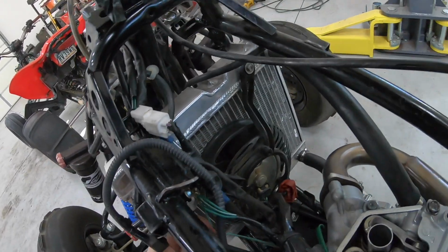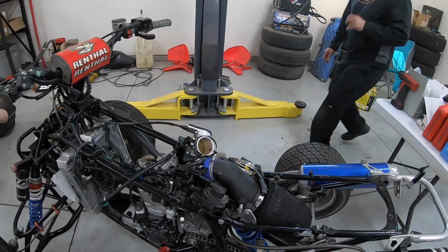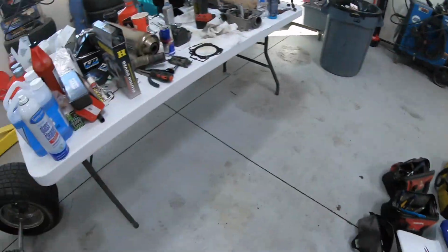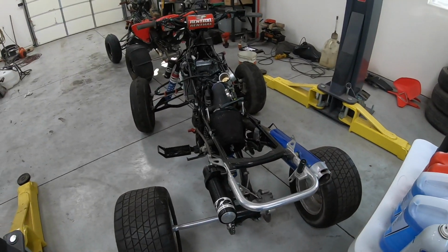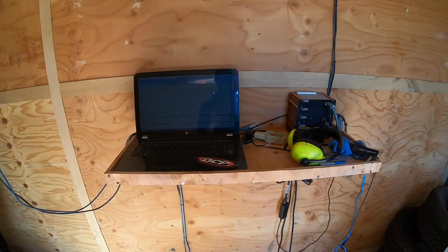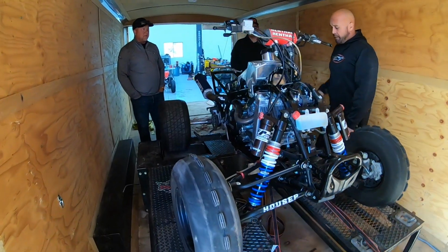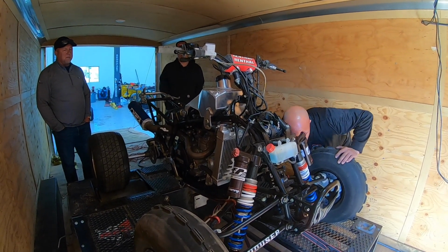Routing. Fuel screws in, plugs in, and choke plunger. There we go. Alright. Clutch cover on. Check on the clutch fibers. Check on the oil. Oh, we gotta do oil too. So we're starting at 60 and a half and 35.8. Just gonna do same map and see how it handles first. I'll do some pulls for seating. Oh, okay. Start. Got it. Make sure oil plug stays in.